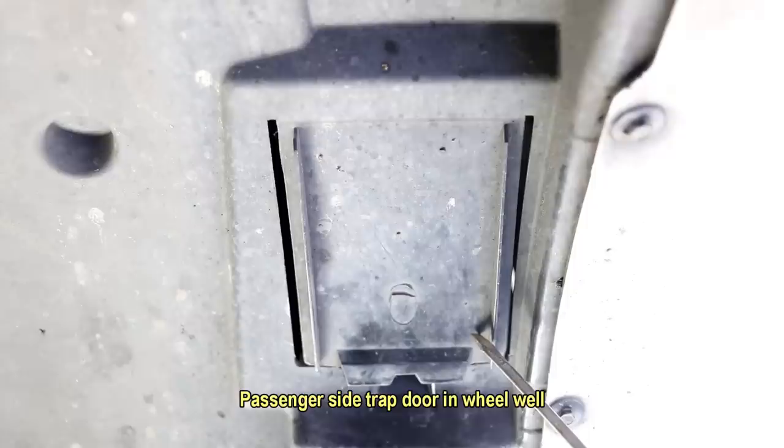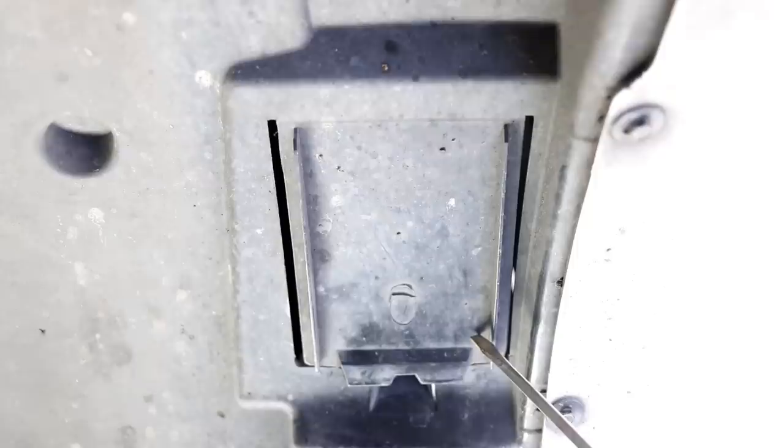The last thing is your active air intake system on your air cleaner. It sucks air through the grill in the front, which you can see pretty readily. Down in this wheel well there's a more or less dryer-hose-looking duct — it's not a very high quality hose. Some people have reported that it deteriorates over time. I'll show you an easy way to check it because it's very difficult to see; you have to tear this whole fender apart to really get to it.